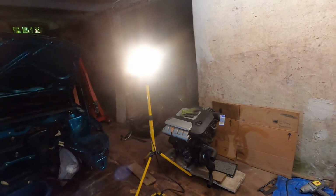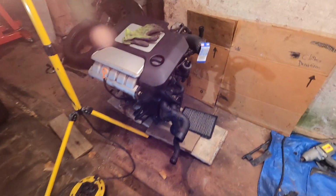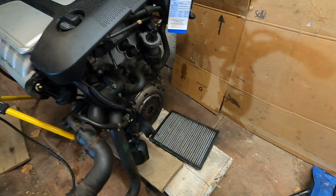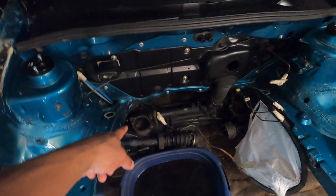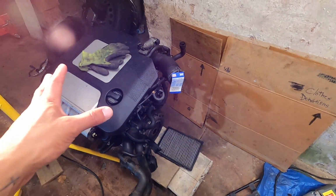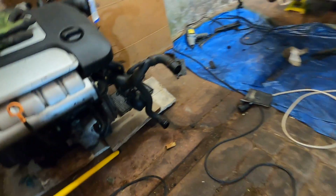This will also be a really cool opportunity to show you guys exactly how these Fabless mounts for the engine work. In case you were thinking about getting a set for your car for a VR5 swap, I'll show you exactly how their kit works with its engine and mounts into the Mark III directly. Now, I do realize there's no transmission on this engine yet, so we won't be able to use the Fabless Manufacturing O2J mount to go right there, but we can use this rear mount and the tubular front section with the solid front mount. Since there's no weight on this side, that should be enough to have the engine just sit in place for now and not be an issue. Like I said, that Fabless VR5 mount will go right back here, utilizing the factory Mark III spot versus the Mark IV mount on the side, and then obviously we'll have the one that goes into the front down over here. So let's get it.